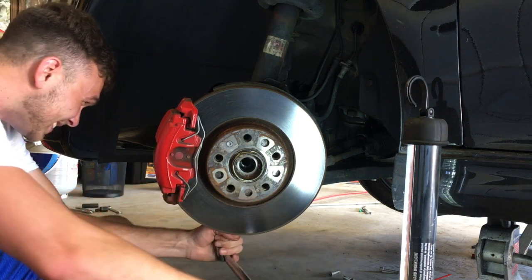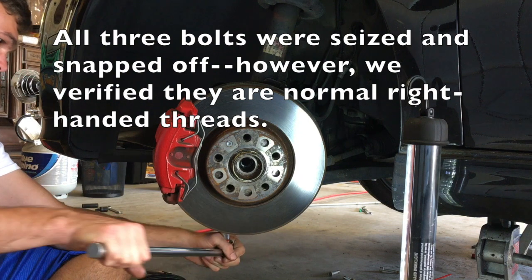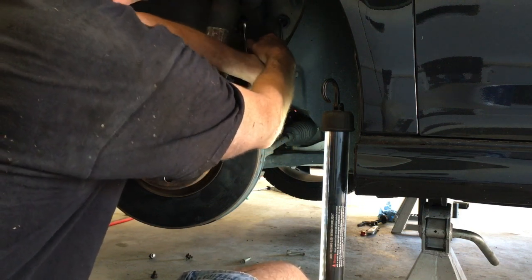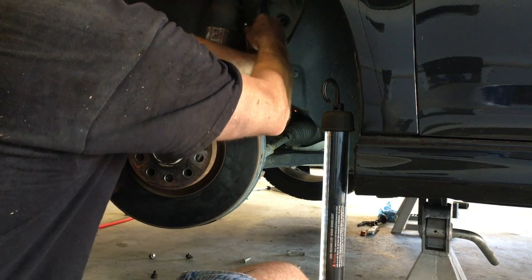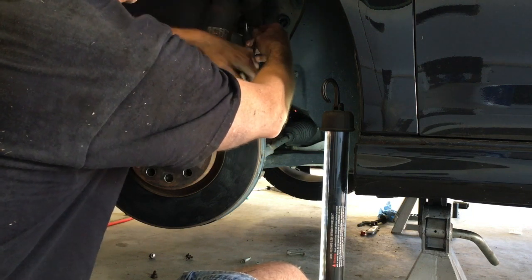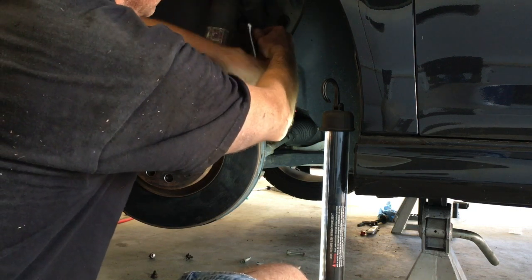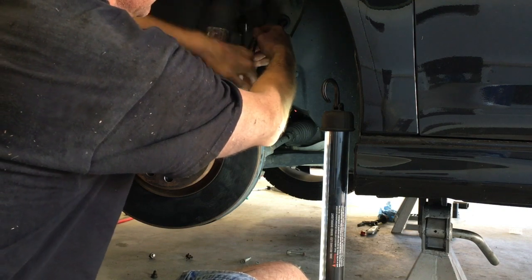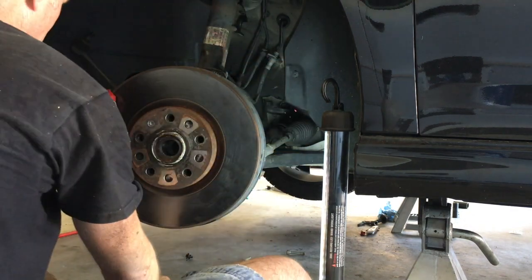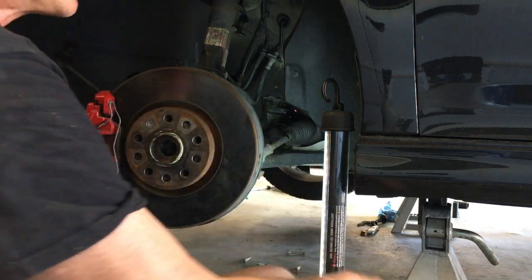That's weird. Gotta picture yourself underneath it. It's a 5 millimeter Allen wrench here, and an 18 millimeter box end. Just to get this. Here, so the sway bar support can be out of the way of the axle. Get out of the way. Now I gotta get the inner bolts.